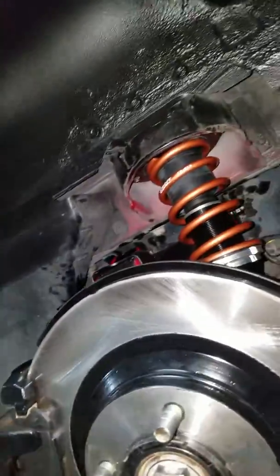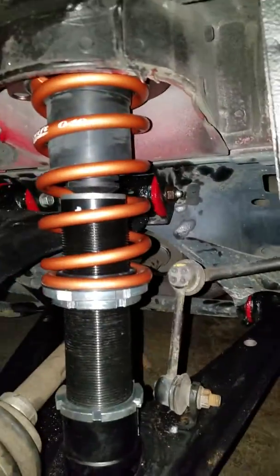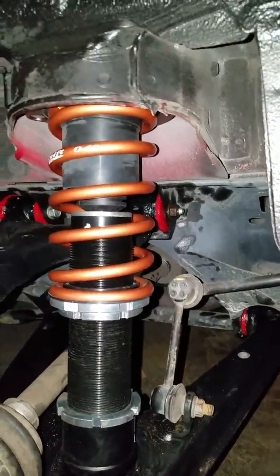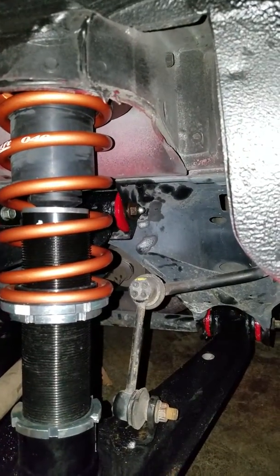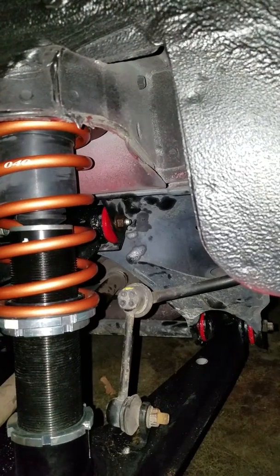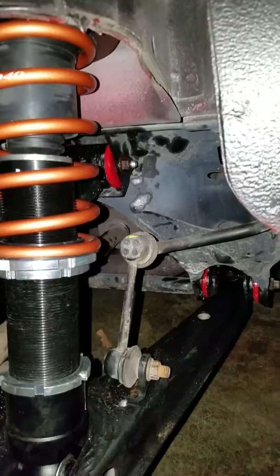Okay Mike, I thought I would just show this — this is what's required to get the 5-inch pinch weld height at the rear fender. And actually this only yields about 4.75, so it really needs a couple more turns.